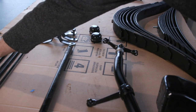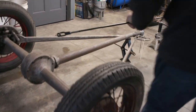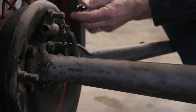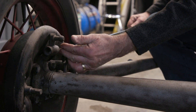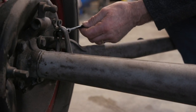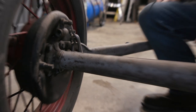For the next video, Tim will be working on the front and rear ends. He's sandblasted the rear end — here you can see the rods where the brakes hook up. One side is for the regular stopping brake: a bracket, clevis pin, and lever pull forward, pushing the brake shoes against the brake drum. The emergency brake shaft fits in similarly and holds the car from moving.